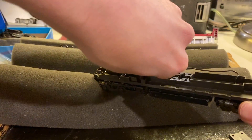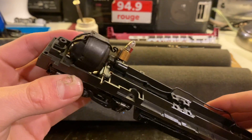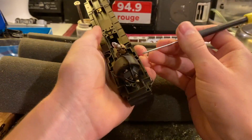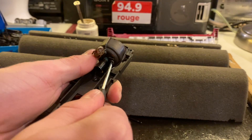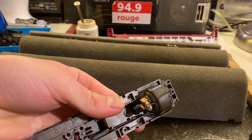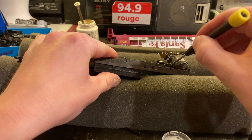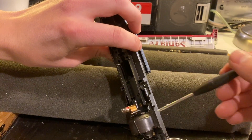That motor is seized really badly — it is jammed and not turning at all. We clearly need to open this up and see what's going on. Something is definitely not right. I'll remove these screws and try to get that motor out. The screws are jammed in there bad too. I'm not generally an advocate of doing this but I really don't have a choice. I'm going to have to put some penetrating oil on both of these screws and hope that unseizes whatever's wrong.